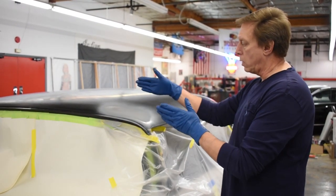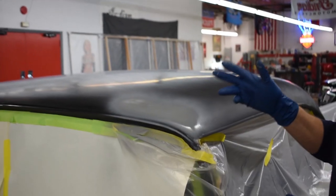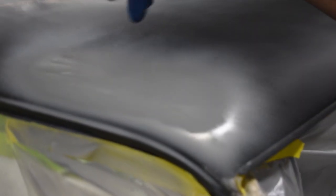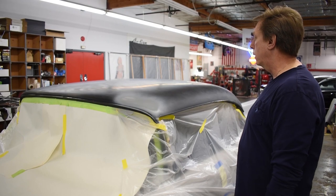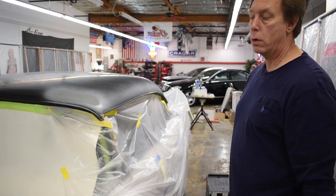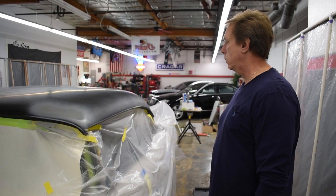What we're going to do is build this area up — we'll probably end up at the drip rail. We'll put on two more coats once this stuff loses its sheen, because it's kind of shiny right now. When it's dry, the edges will become kind of a satin type — they won't have a sheen or gloss to them. We'll let this flash off, go over it one more time, maybe a second time, then let it set for three or four days. We'll go over the whole thing gently, make sure it's clean, and then we're ready for paint — top coat and clear coat — and we'll have an Inca Silver top, which was a stock color in 1957.